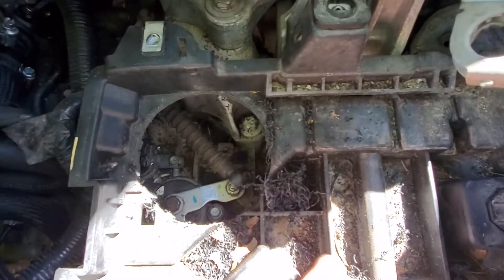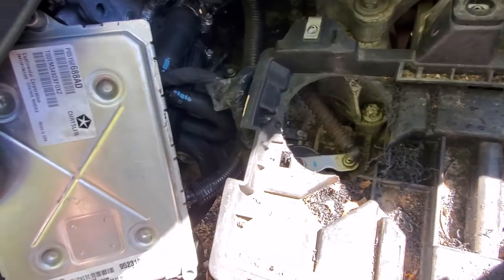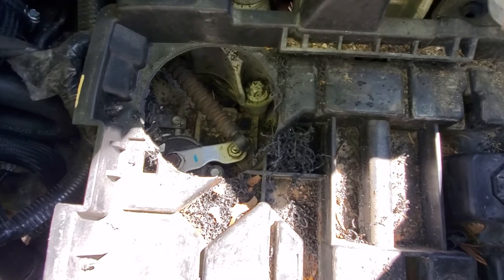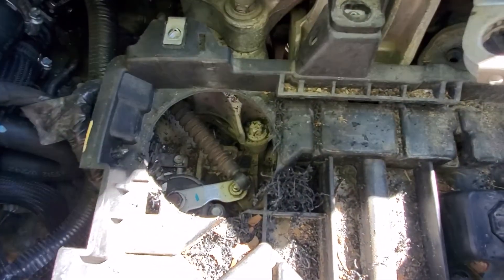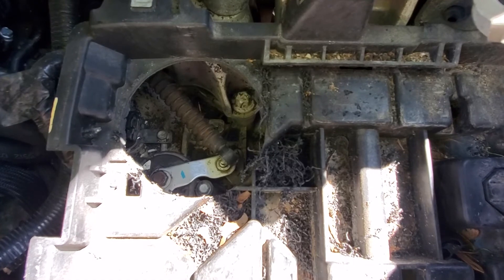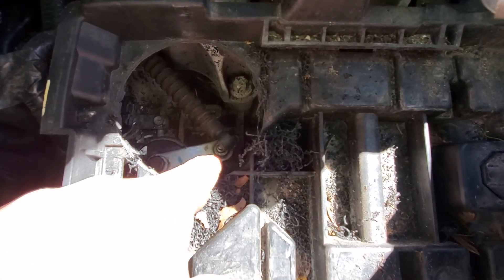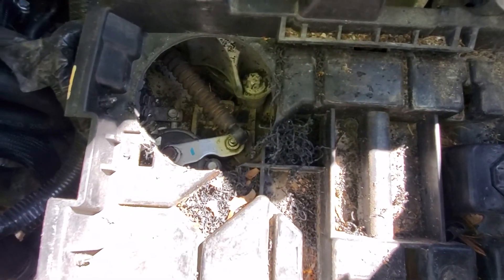They could make a plastic cap that goes over the battery area and bolts down. This thing is ridiculously over-reinforced and I'm not taking out all those bolts and everything that goes with it. If you like this video give us a thumbs up. This is your 2012-2013 Dodge Dart fix: carbide bit, drill it out, push the bolt up from the bottom, put a Teflon washer and nut on it. See ya.